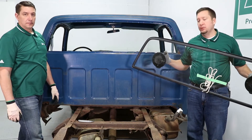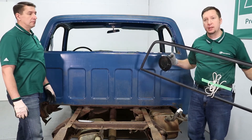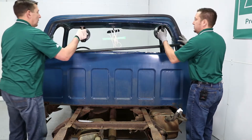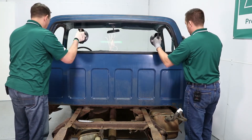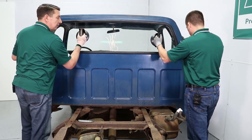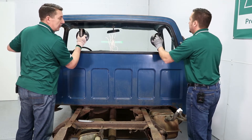We're ready to put the glass back in the cab — the rope side goes toward the cab. We're not trying to install it at this point; we're not trying to lip it over the pinch weld. We're just putting it to the cab, centering it top to bottom, side to side. Now we'll move to the inside to install it.